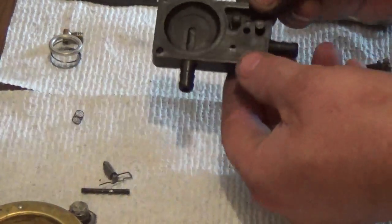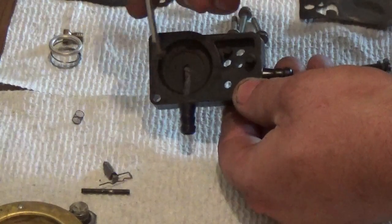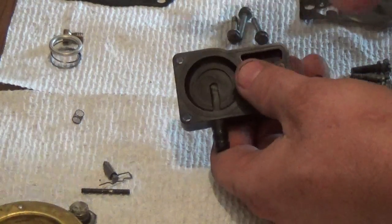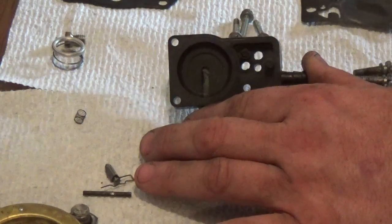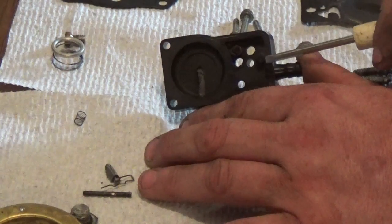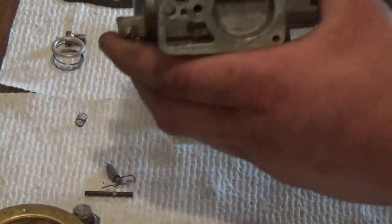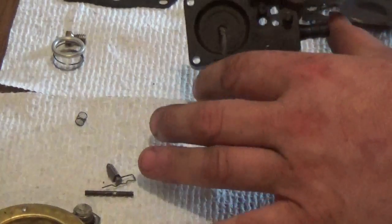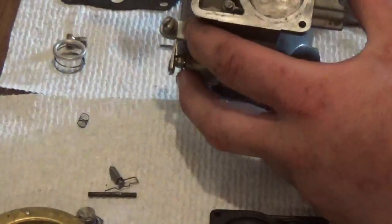I'm going to show you where they go. As you see, this is the spring and here's where they go. They consider this piece a boss. So just remember that these springs — these small little valve springs, if you will — actually go on the bosses of this pump body. Now I know a lot of you would be thinking that this is a boss, but this isn't a boss — this is actually just a locator for your carb. As you can see, this actually goes right here. So this of course is where one spring goes on the pump body, and this is where the other spring would go.